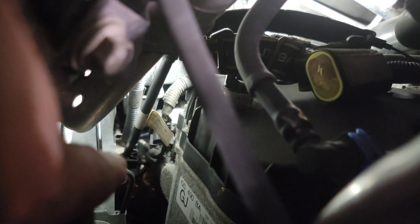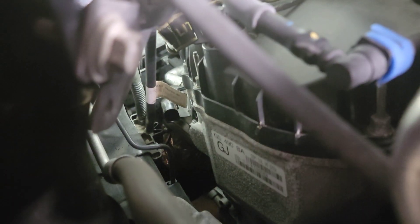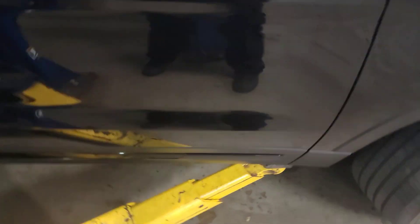I'm going to come up here, and right at the back there's a black connector right there. That goes down to your lower oxygen sensor — that has to be unplugged. The tab is on the bracket side, which is kind of a pain. You've got to pull the O2 sensor out of the bracket, then flip it around and press the tab in while you pull on it. It pops out of there. Now let's go underneath and pull the exhaust off of the converter.